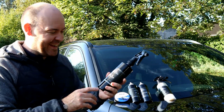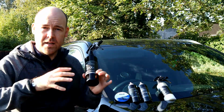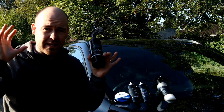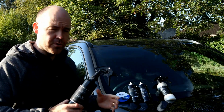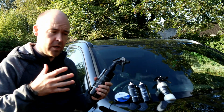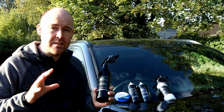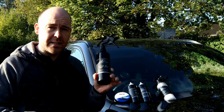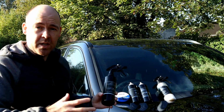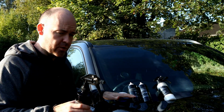Easily distracted. So another product that I reach for all the time coming into autumn and winter would be Wax Plus. So Wax Plus is a necessity for me in terms of the upkeep of the paint, especially if I don't have the time or the weather isn't in my favour. So with Wax Plus, it will give you about 6 months of one application. It's a silicon dioxide spray, but it's what we call reverse compatible with the waxes. So actually, it's fully compatible with the carnauba waxes.